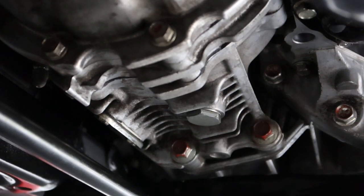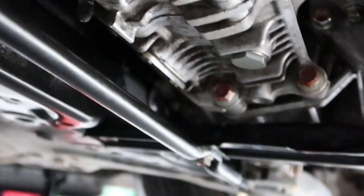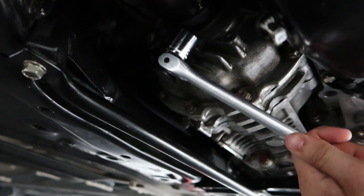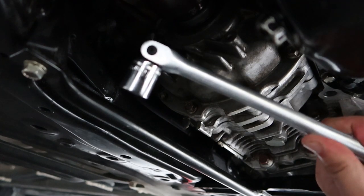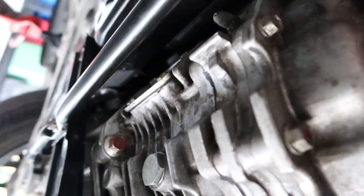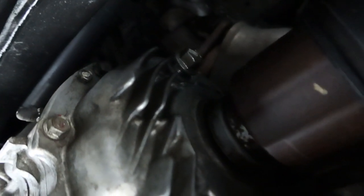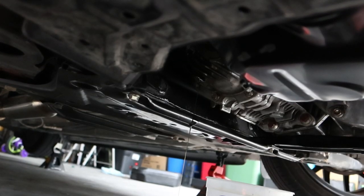Like the rear diff, we're going to pop off the fill plug to get airflow through, then drain it and log how much comes out. Quick update: the wrench will work but a socket is easier since I have the tools. Here's the 17mm socket on a little breaker bar — and boy, that was tight. Speaking of torquing, I'll leave a link below with all the torque specs for everything I'm doing today. I'm not going to pull the plug all the way out just in case more fluid comes out like on the rear diff.